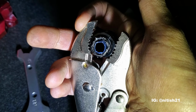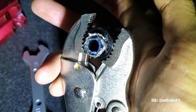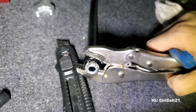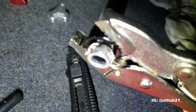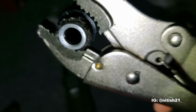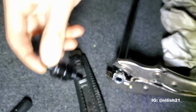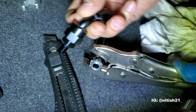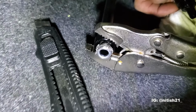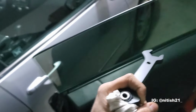All right, so there you see it. I've actually flared the outer metal mesh from the Teflon, so now we can drop in the ring. All right, so we got the metal ring in there. As you can see, I've also tucked the Teflon under the inner lip as best I can. I'll probably try a little bit more once I pause the video again. But now that it's tucked in, we can put a little bit of oil on the end of this guy, and then we're going to put it inside there, tuck it in, and then these threads are going to be able to catch on the inside of the threads inside the lower outer layer of the fitting. Then we'll thread it all together like I did the other one, but this time we can actually use the vise. So we're going to use these metal blocks on the vise and get that done.